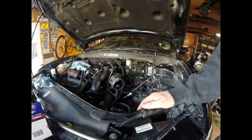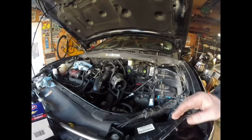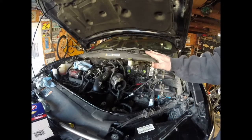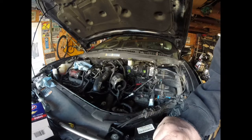It is just really difficult. On that top bolt, you don't remove it all the way — just take it out until the starter comes free and leave it in there, because it would be really hard to get that bolt back in after you take it off. I am going to show you the top stuff first. Underneath, you have to remove a couple things: the oil filter and oil cooler, and then there is a bracket. The transmission mount area has to be accessed to get to it.